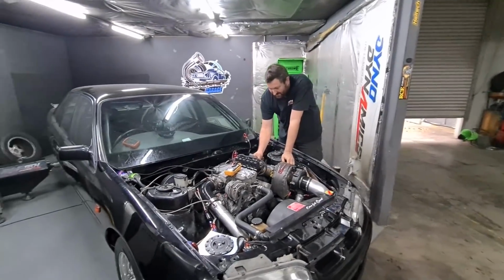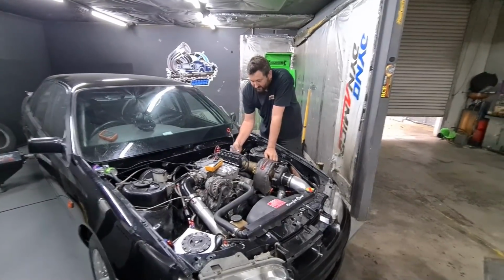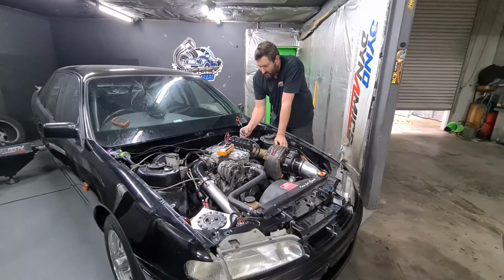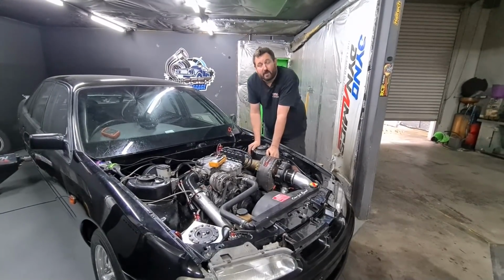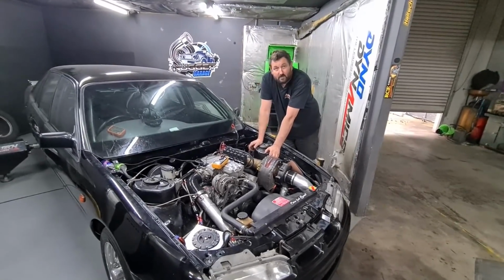I'm pretty sure it's done valve damage. And so you mean sitting it on limited didn't fix it after all? Well, it might have. But it's just got something there, it gets worse when I put more boost in it, which kind of tells me it's probably a bent valve or something. So I'd say there was a nut. That noise was probably something going through the exhaust valve.